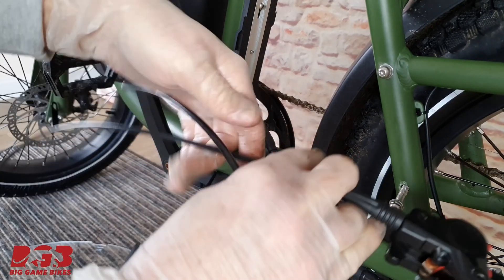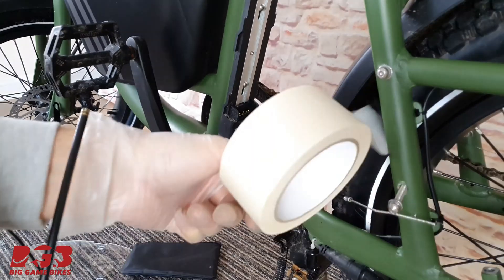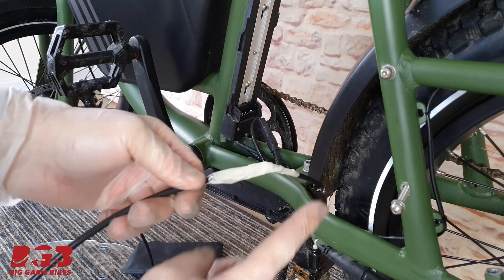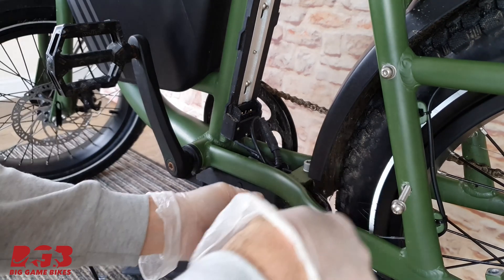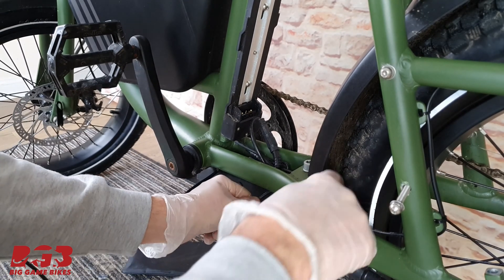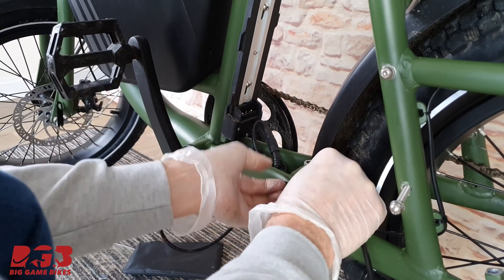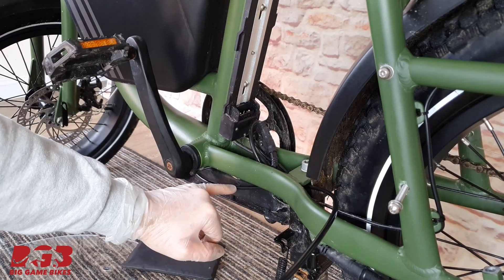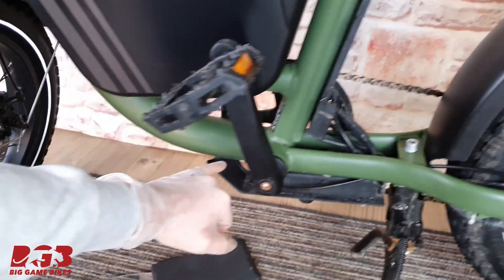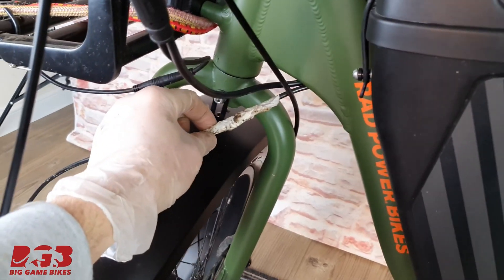Let's attach the new hydraulic brake to this line. On your new brake, follow the line all the way to the end. Get yourself some masking tape and tie this to this like that. Using our trusty masking tape we've taped this up, and now very carefully feed this through. You need to do it carefully because if this breaks it's going to make it very tricky trying to feed this hose through your bicycle. The brake housing has very gently been fed — there was a sneaky cable tie just behind there so look out for that. That's been fed underneath here all the way up the frame and there it is coming out.